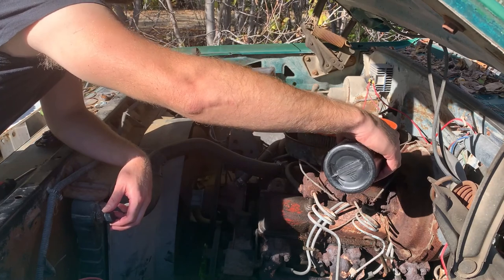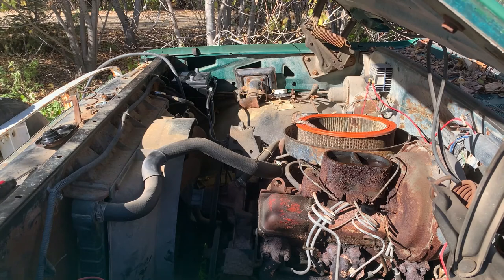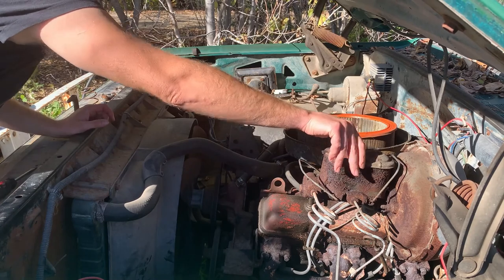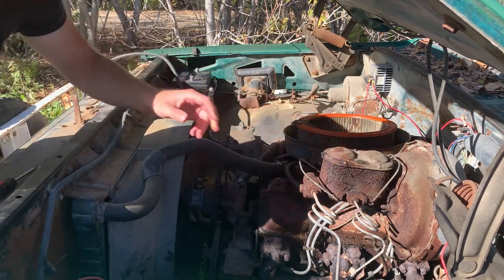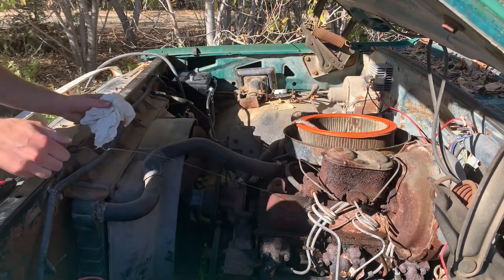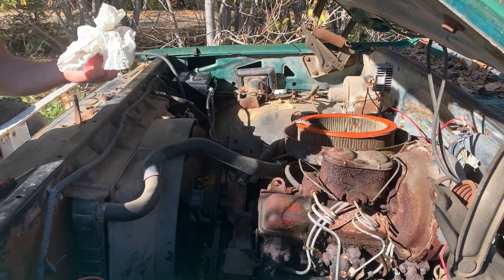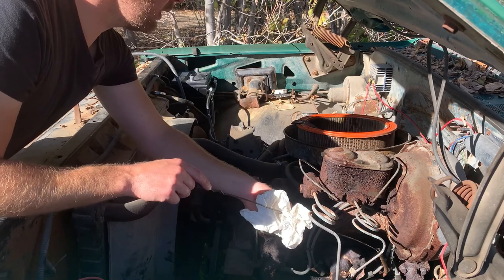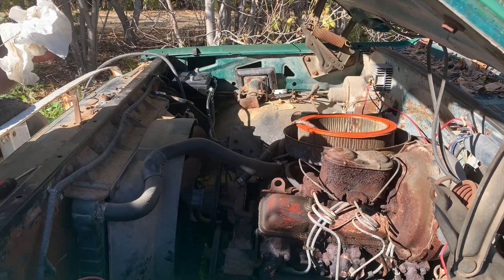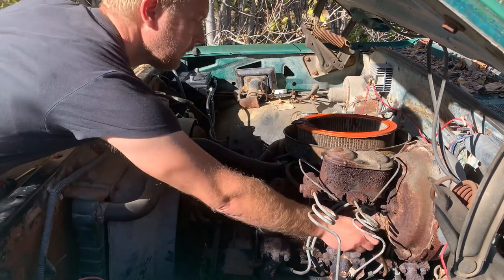Nice. Just leave that hang loose there. You bubble down. Oil is, oh, that comes out easy. Oil is, whoa, severely overfilled. I'll just double check that. It can't be that bad. Maybe it can. Oh yeah. There's a lot of gas in it, so we'll dump that.